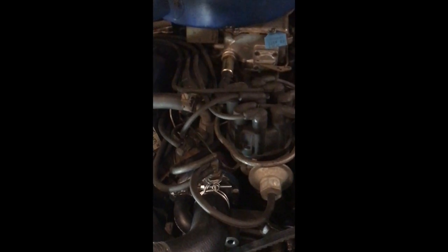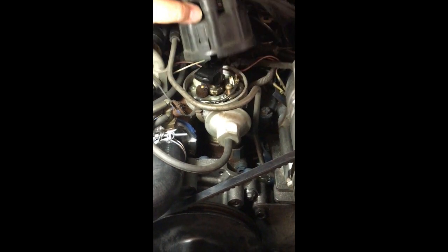After cranking again, I'm picking this up to see what I have on the screen. That's about maybe seven degrees — just a little in advance of six degrees before top dead center. A degree or two, even ten degrees out from where I want to be, the engine will start. Now I'll take the distributor cap off again and look at the position of the rotor — and now it's pointing back to where the number one cylinder position is.